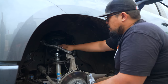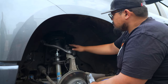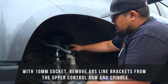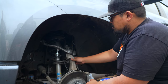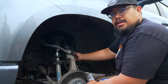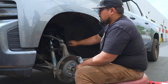In addition to taking off the old 5100s, we're also going to be swapping in new Bilstein upper control arms. First thing we're going to do is remove the bolts holding the ABS lines on the upper control arm up here with a 10mm socket, and then down here we're going to remove this 10mm bolt and this 10mm bolt back here. This is going to allow us the most slack so that we don't accidentally pull on one of these wires and ruin your day.